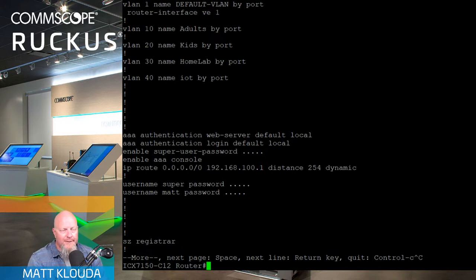Or, I mean, if you want to put your main network in the same VLAN, you might even want to untag it in VLAN 10. My setup is different. Mine is in bridge mode, which yours probably is too. So you can do whatever you want internally. You just have to have a specific VLAN or port for your cable modem, right? We're worried about internals. So I'm gonna take 1/1/1, 1/1/2, and 1/1/3, and I'm gonna tag all those ports in all four VLANs, okay?